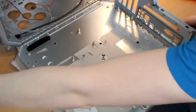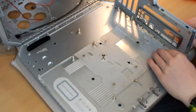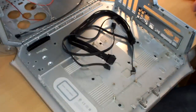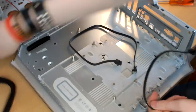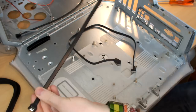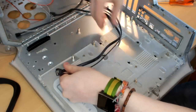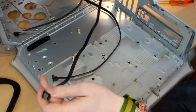All eight motherboard screws safely set aside. Before we lay the board down, I actually need to lay some cabling down because I want to try to see if there's enough space to run the eight-pin and two SATA cables round underneath the motherboard. Here are the cables I'm going to try and squeeze underneath. These SATA cables will definitely go underneath — they're the right-angle ones, so they're going to go like this under there for the drives.